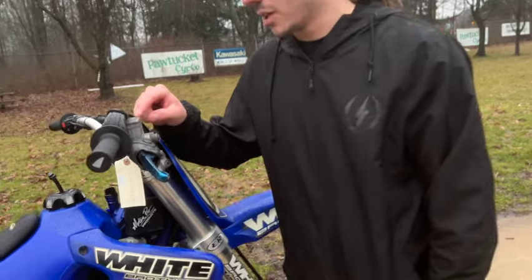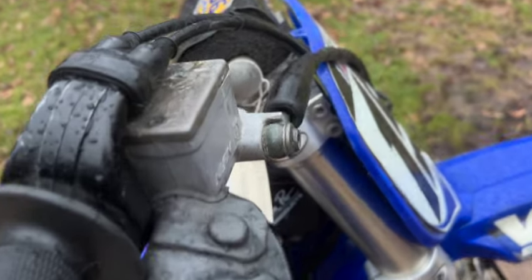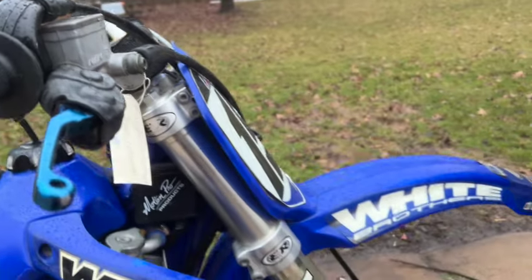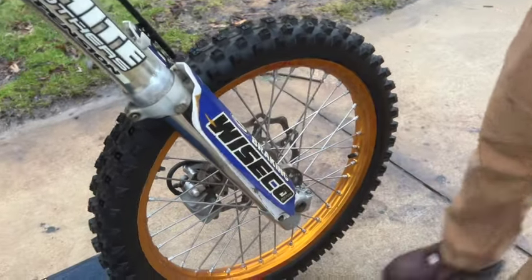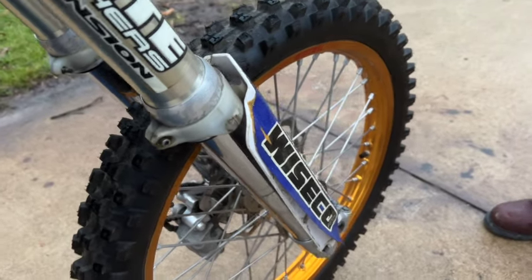What else I forgot to mention as I was working on it — the front brake works good right now, but it looks like somebody stripped out a screw at one time. I don't know if they epoxied it or JB Welded it or something. I didn't mess with it because the front brake's not sticking and it's stopping really good, but you might want to look at it in the future. The front forks are also leaking just a little bit — I didn't even try to clean them off or mess with them at all, so it might be something you want to check into.